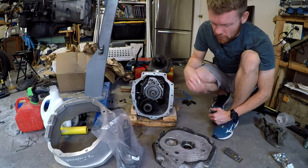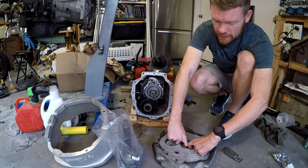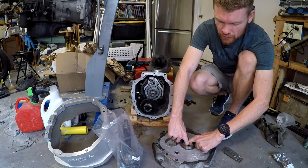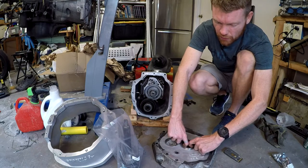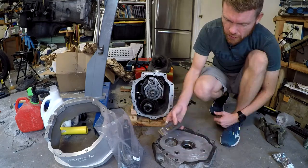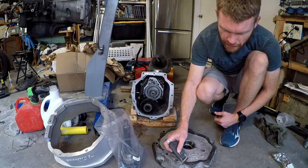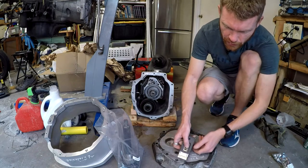I'm still working on the garage floor because both workbenches are full. I've replaced the input shaft bearing since I didn't know the condition of the shaft when I got it. The outer race slides out really easily. I'm using a new razor blade to go around and clean the surface area, then wiping it all off with brake cleaner when I'm done.